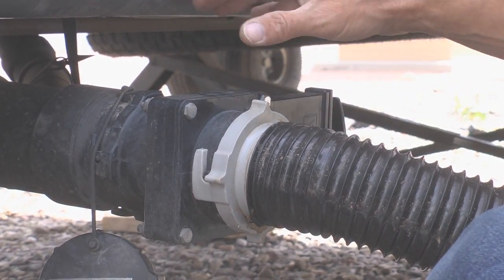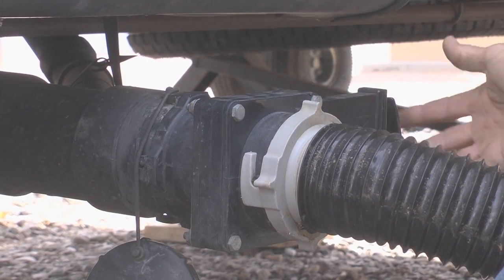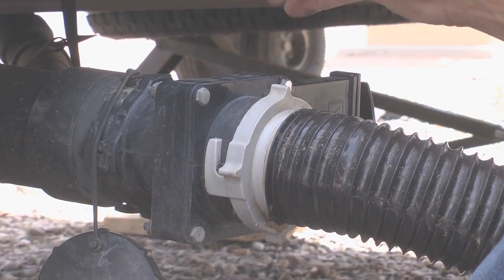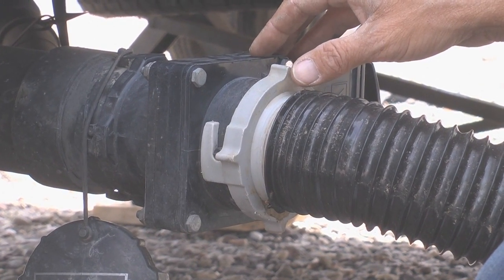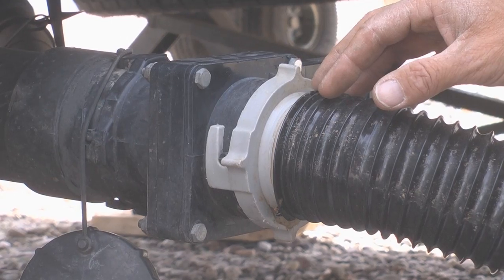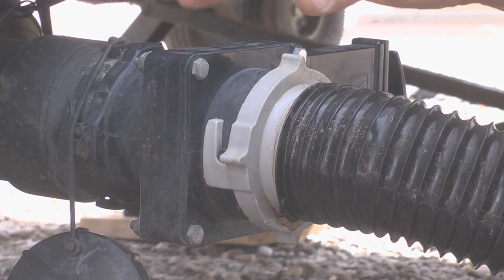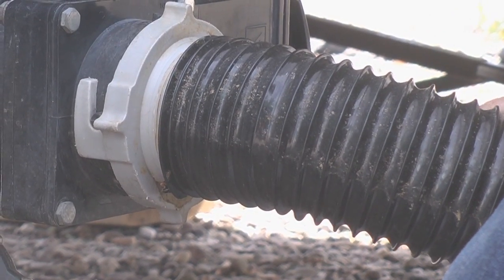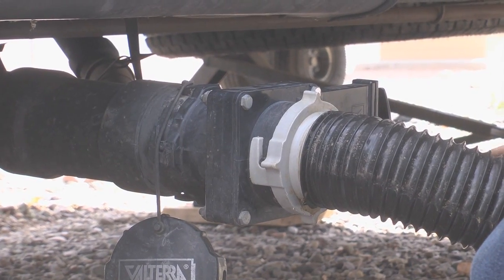It's female and male, and the valve itself attaches right to your main drain pipe on your black and gray water tanks. You can see right now that the valve is closed — the handle is in. This is just a standard gate valve, available at all kinds of different RV supply places like Camping World, bigger department stores, or online for anywhere from $17 to $30 depending on how you shop around. The principle of this is it will allow your gray tank water, instead of running right out your drain pipe, to flush back into the black tank, kind of stir everything around, then allow that black tank to stay a lot cleaner with this simple addition.